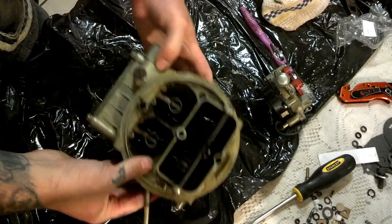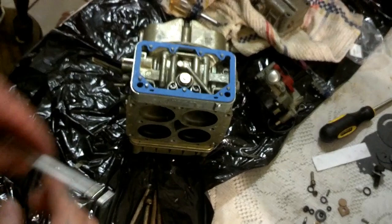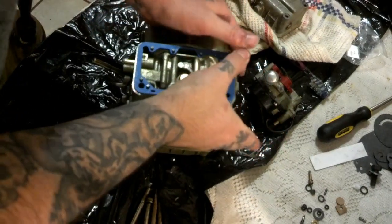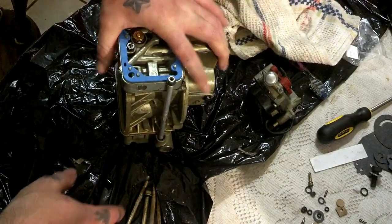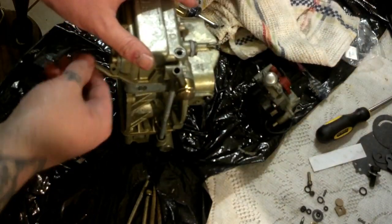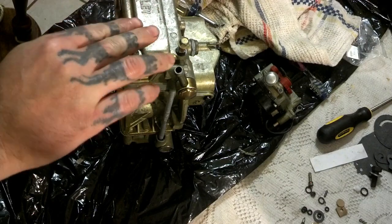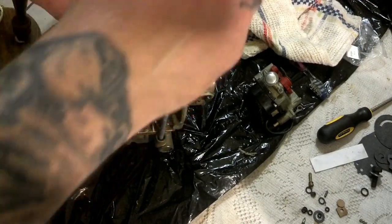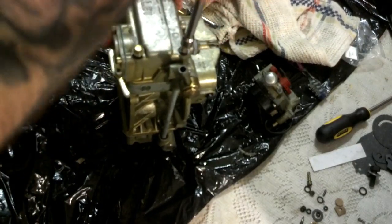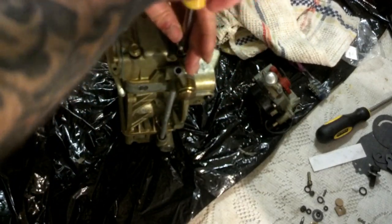Okay, we got that side assembled and done. What a pretty Holley. Next we will want a feed tube. Next thing is put your O-rings on this and feed them in the bowl like so. Once you get that, you can take your bowl which is already assembled and put it on just like so. Now your four bolts go here, here, here, and here. Make sure you got your seals for your bolts on it. And now your bolts should start and screw in easy.